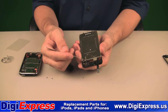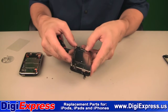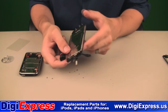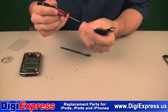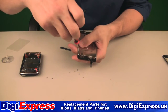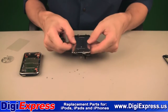You may have difficulty with a small grounding clip shown here. Gently lift the tab to allow the LCD screen to sit in the midframe. Now reinstall the screws, making sure the holes for the screws are properly aligned.